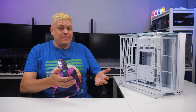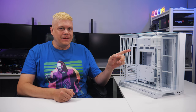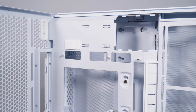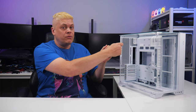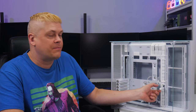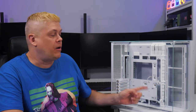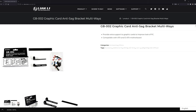For improvements, I'd like to see the reset button make a comeback, and the power button either slightly larger or back at the corner. The CPU block pass-through is a little small and tricky — some kind of screwed-down cover you can simply remove to pass tubes right through would be a cool solution. I'd also like better adjustability for the GPU support: it has height adjustment but no swivel or lateral flexibility, so hopefully the post clears your GPU's fan blades. If it doesn't, Lian Li does sell two different anti-sag brackets.